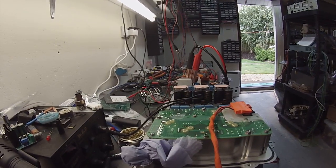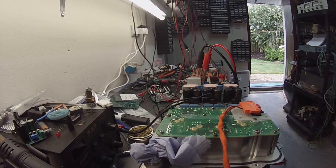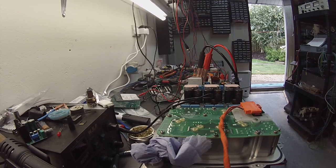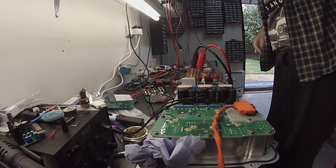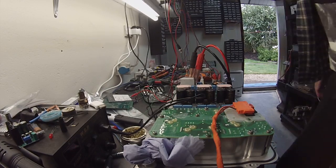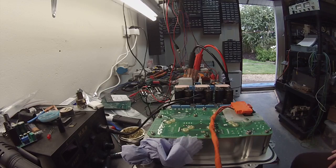Oh, that's different! I can actually see the lights flickering, but what's happening is my voltage is diving too much. I can see on the multimeter that we're dropping well under 300 volts — if I put the multimeter graphing function on — we're diving down to about 280 volts. So that's obviously where Elon decides that we shouldn't really be trying to start the DC-DC converter.